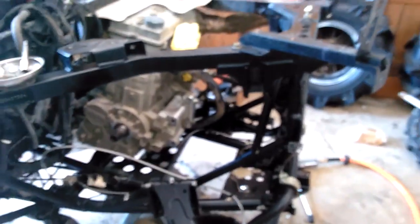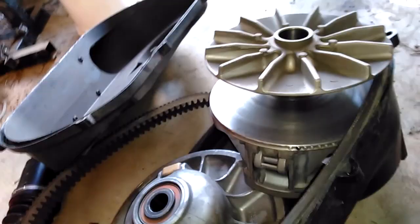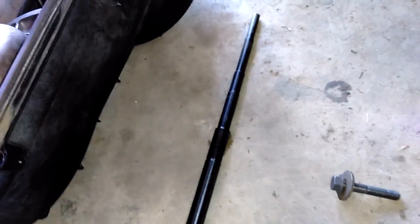I confirm this does work, so pay attention. I got the transmission out — it's a lot more work than I was led to believe, and it's also a lot bigger. Having a second person would have helped; it's not super heavy but it is bulky. I managed to get it out leaving in the piece that converts the engine to the transmission and the drive shaft — I just snuck it out and pulled it backwards. The bolt holding the primary gear on was extremely tight — not the bolt really, but the press fit. I maxed out the pressure on my puller with the impact and then smacked the end of the puller with a hammer four or five times and it popped off.